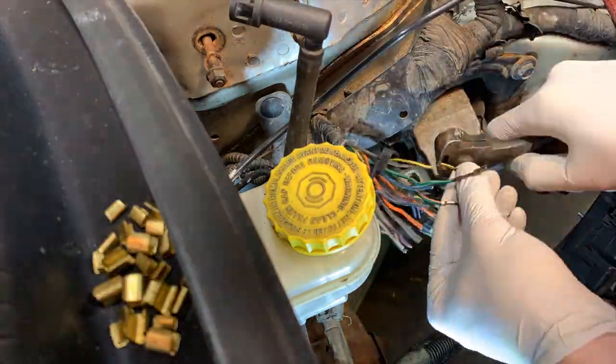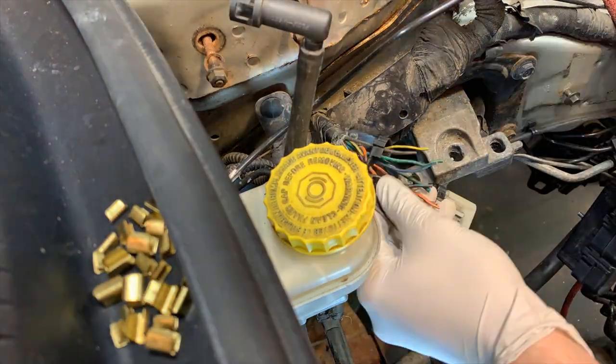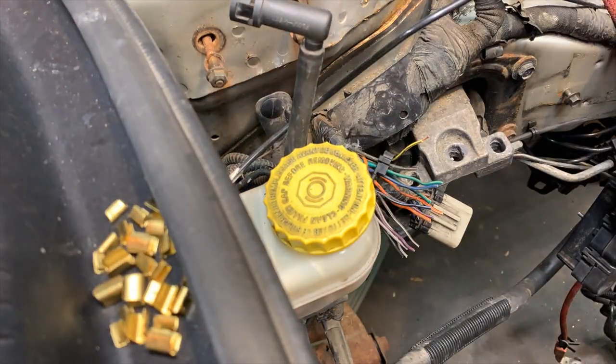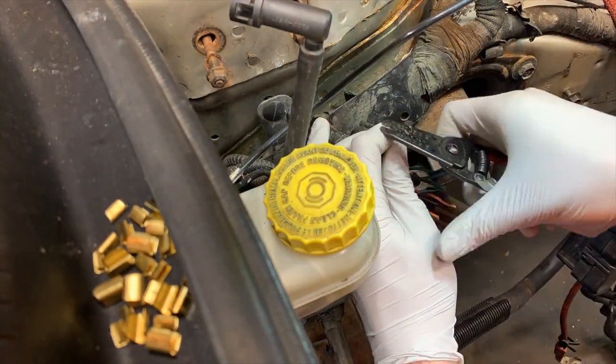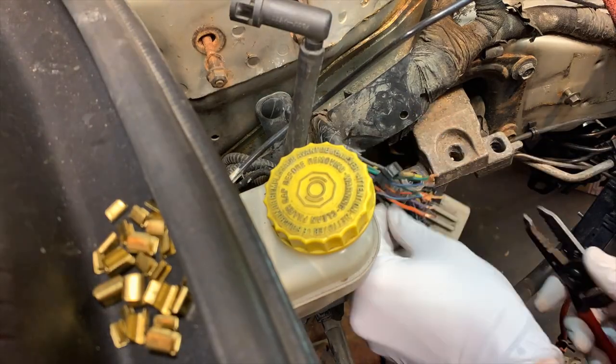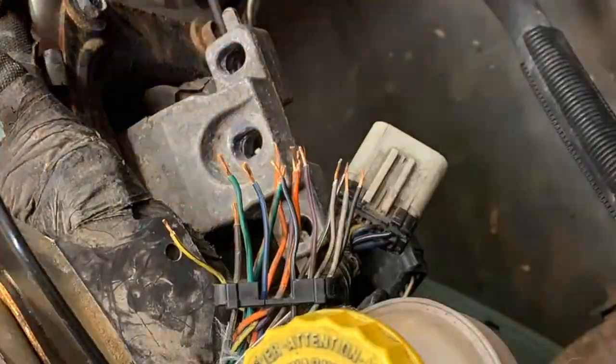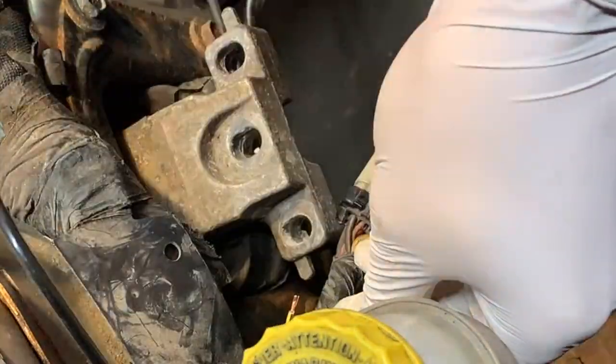So we're gonna start by cutting back all of those wires there. Move the original cap back to keep the order correct. And now we're just gonna go through, like I mentioned, the same exact process you saw me do on the engine harness. We're gonna strip, crimp, and heat shrink all of these connectors, and then get the new connector end pinned on and get it connected up to the engine harness.